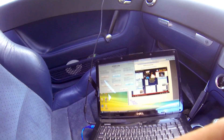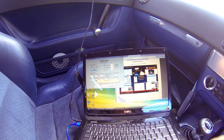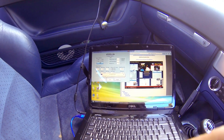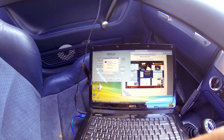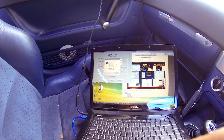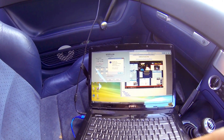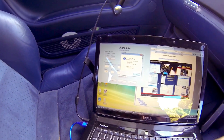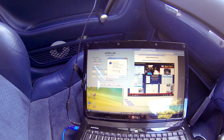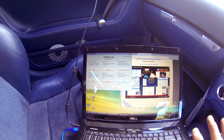So first of all you need to set it up. You go to options and you've got your ports here. You need to test them first. This is VCDS Lite — there are four ports here, COM1 to 4. Test all of them. I found out that COM4 seems to work for me. It says port status is OK, interface found, and latency is good. You need to make sure that the latency is good always. Save your details and that's done.